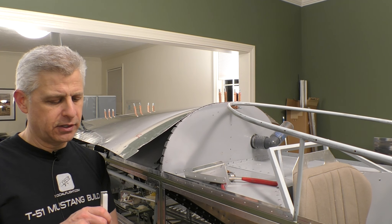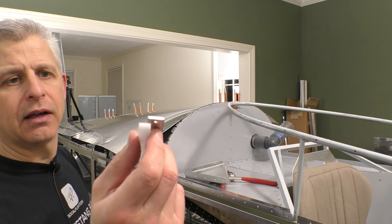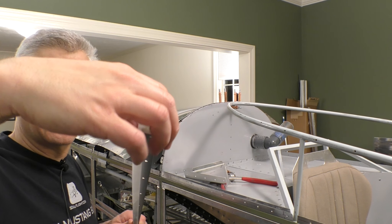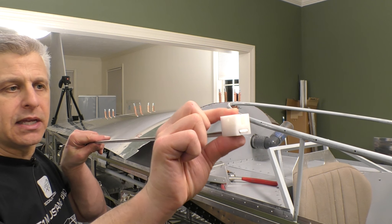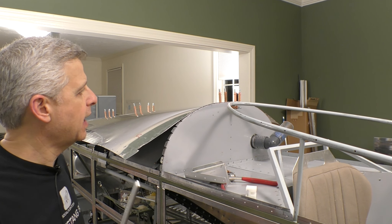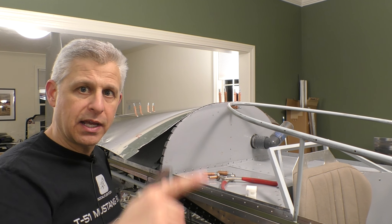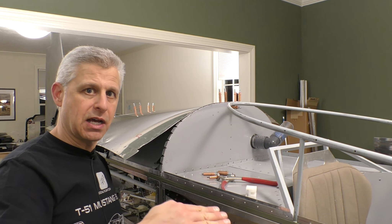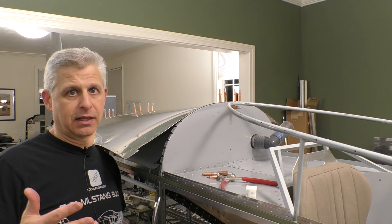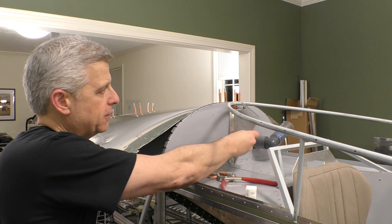The way the aft canopy track works - I'll show this to you - it's a little stack-up that kind of looks like a monorail. It's this piece of nylon down here, and on top of it is this piece of aluminum. Then you have this carriage that rides on top, and the aft canopy has a guide that runs along this as you slide it back. At the forward edge, there's a piece that allows it to come forward and then down, because the canopy actually comes up in the back, slides back following the turtle deck, and as you bring it forward, the back of the canopy pushes down and secures into place following this track.